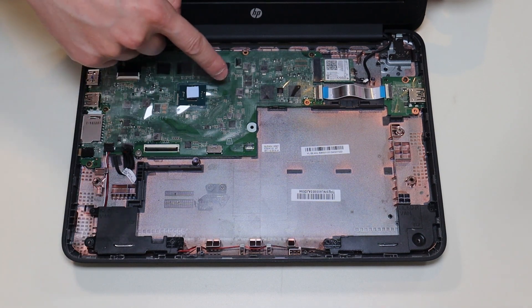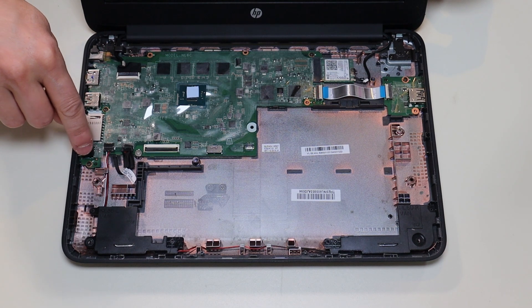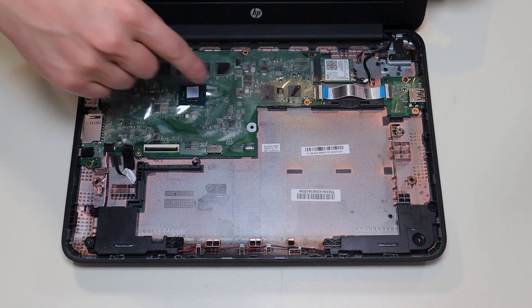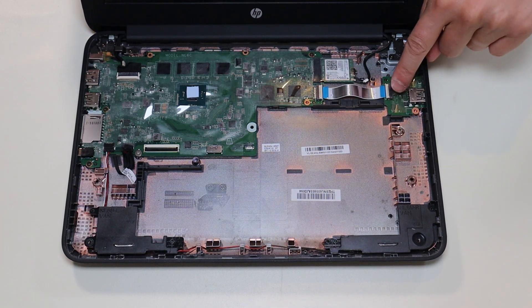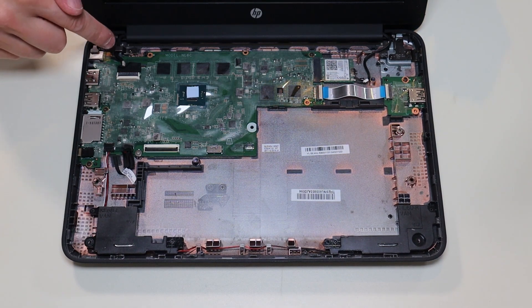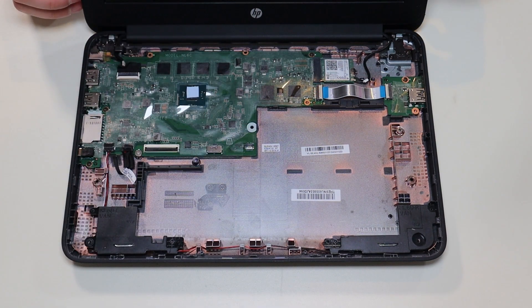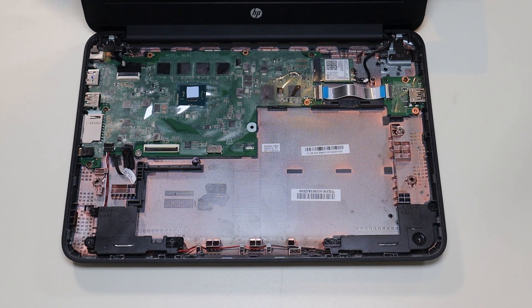Your motherboard is here. To take the motherboard out, you have to undo all the motherboard screws — you'll note which ones they are because they'll have a white arrow or white triangle next to them. You will also have to unplug everything else: your USB board and ribbon cable, your Wi-Fi card, your LCD cable, and your power jack. You'll have to unplug everything before you take your motherboard out. I'll also try to include a motherboard replacement in that link below. They can be hard to find, but if I can find some, I'll try to have them there.